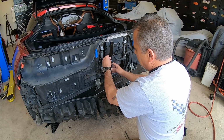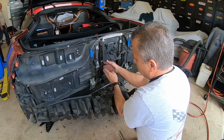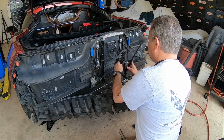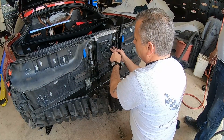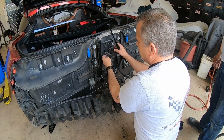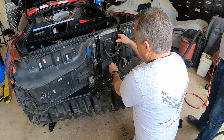So you can go ahead and put this up inside there like so. Your screw holes are going to mount up. Then you do that on this side also. This is your tire pressure monitor here, and we're going to relocate that. We're just going to pull it loose for right this second, scoot it out of the way, and put this bracket in its place.